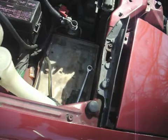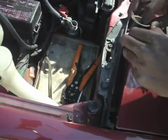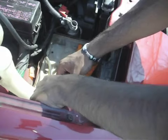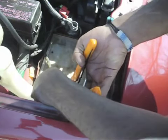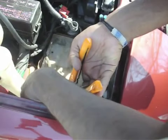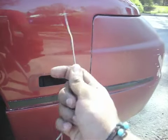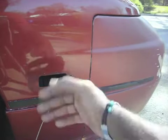At this point, you're going to want to go back under the hood. Basically, you're going to want to tape off the black wire from the harness coming out of the car, and you're going to want to strip the red wire. Then from there, you're going to take the black wire from the harness that plugs into the blinker and splice that into the red wire coming out of the car. So now we have our harness back in the front — I've spliced the black wire with the original red wire coming from the car's harness.